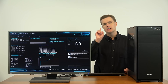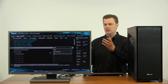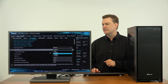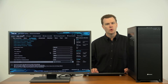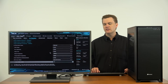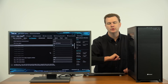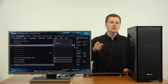Switch XMP back to disabled and press F7 to go into Advanced Mode. Press the right arrow key once and come over to AI Tweaker. Under AI Overclock Tuner you have three options: auto, manual, and XMP — put it into manual mode. You'll see the CPU strap says 125 — don't do that, set it to auto. Leave everything else to auto, base clock at 100. Come down to CPU Core Ratio, set it to Sync All Cores. Then come down to the one-core limit ratio and type 42 — press enter and it will change all of your cores to 42. 42 times 100 is 4200, or 4.2 gigahertz.